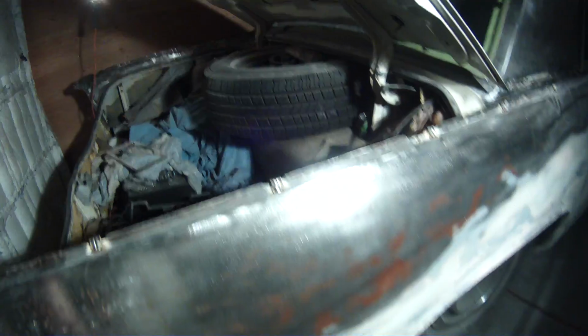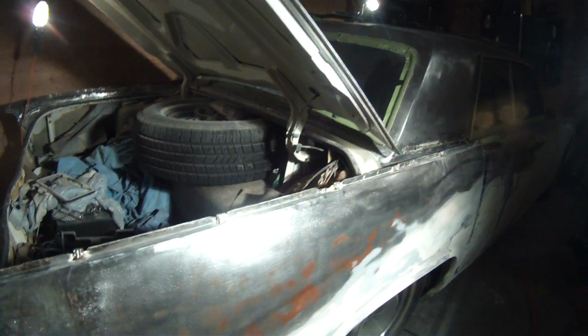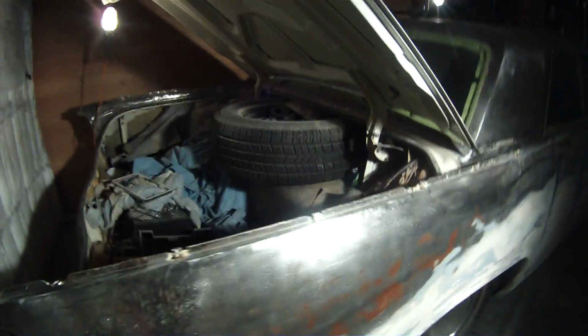Friday, this car was hit, quarter panel and door. Alright, big dents. On the door, the deepest part of the Bondo is about 3/8 of an inch. I might be able to bang the door out. Or if I get a skin, I could change the skin. On this, it'd be easy to do the whole skin.